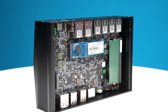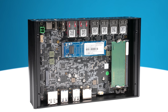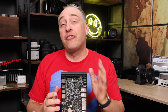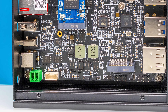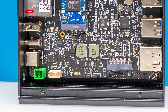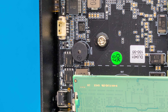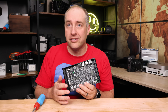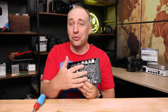For those doing high-end virtualization, they'd probably want faster storage and a higher-end processor — this isn't really that class of device. For modders, there is an additional DC input and a hard drive power port on the board. I also wish the fan used a normal four-pin PWM header instead of the proprietary one here, because that would make fan modding much more accessible. A 120-millimeter fan would provide a ton of airflow.